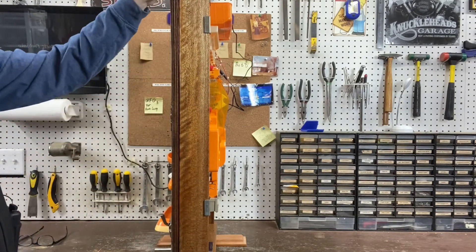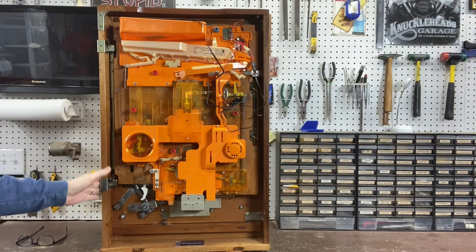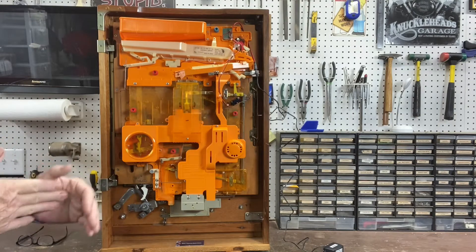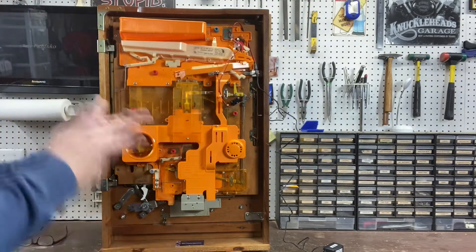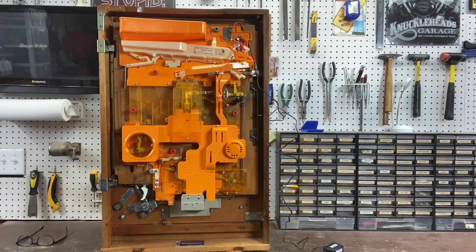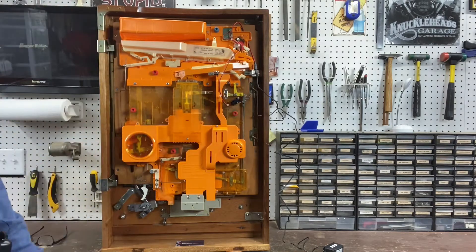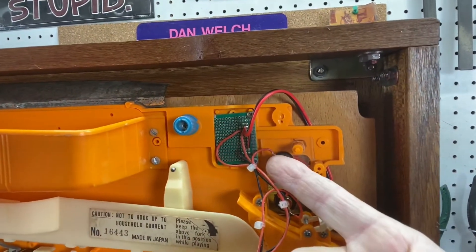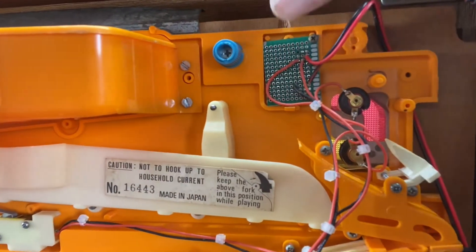As always I take care of the wood. This is beautiful red mahogany — can't find it anymore, it used to be quite plentiful. This particular one: when they take pachinko machines out of the parlors they typically just take the power connection up in here and either unplug it or cut it off, unscrew the thumb screws, and the machine comes to the United States. This one had that done and everything else was pretty much gone. The micro switch was here and there was a leaf switch but all the wires were gone, so I redid all the wiring. When I don't have any remnants of a circuit board I make my own — just a little breadboard. I bring power in from my 12-volt power supply, red and black.